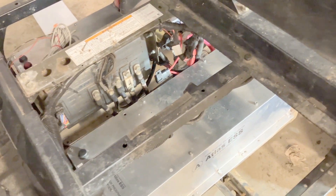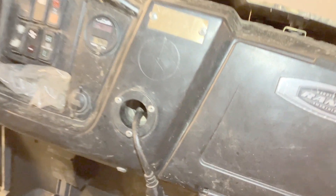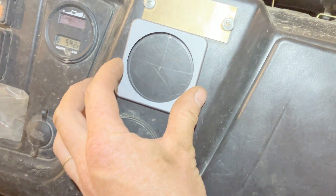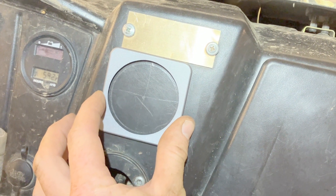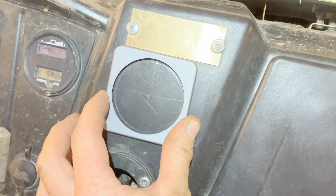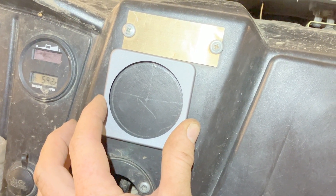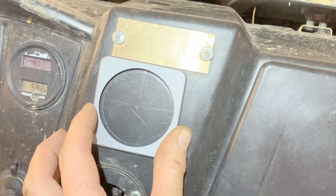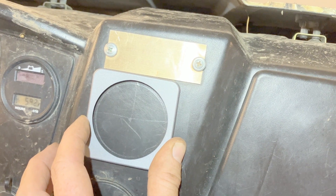Aside from the idiotic error on my part, that was pretty straightforward. For the Victron, I just drew a circle as a template — this isn't perfectly straight but it should be good. They wanted a 53mm hole saw; I have a 54mm, which I think is two and a quarter inches, so I'm just going to use that because I don't have anything smaller and two inches is too small.